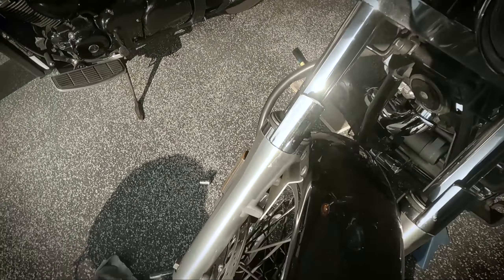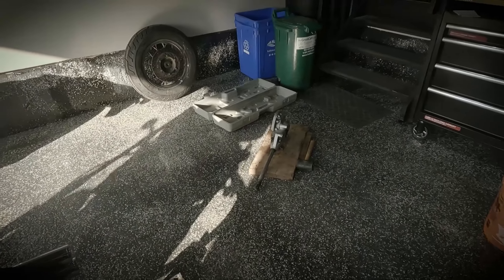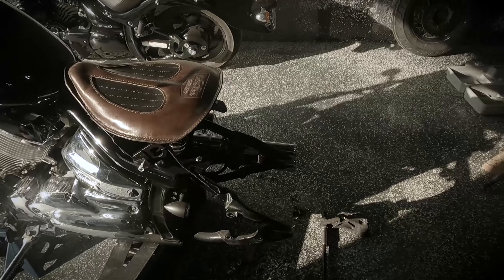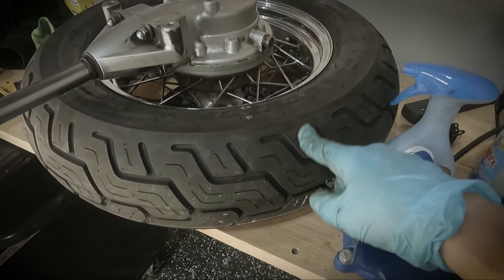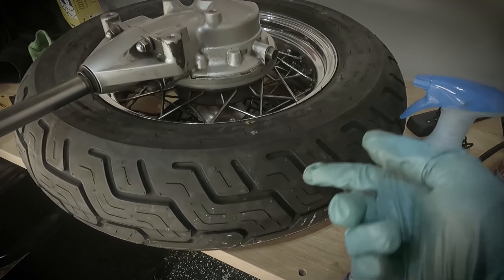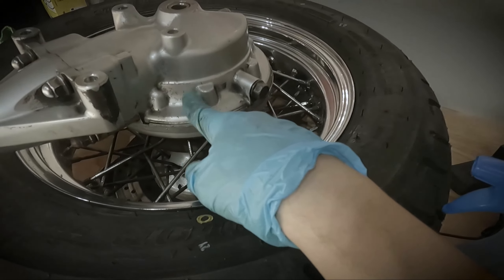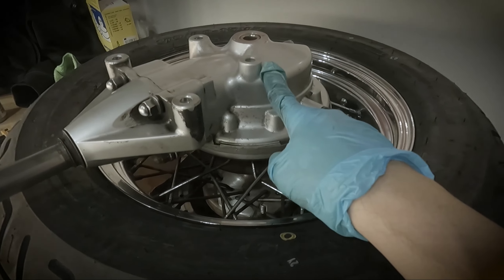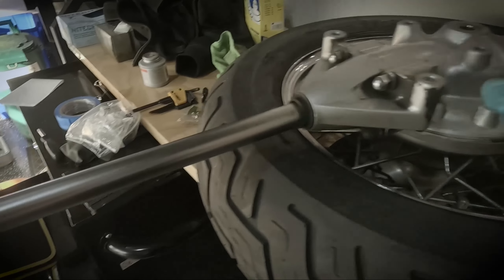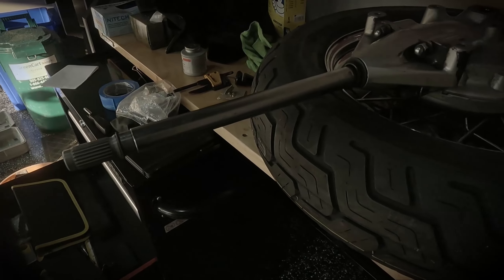It rotates, it brakes — it's good. Let's do the same with the rear: clean up the old grease, clean up the wheel, and get it on. The wheel is ready to be mounted. I had to pump it up with more air because the bead wasn't set in one spot, so I sprayed it with more Windex to get it slippery so it could pop and set properly. I cleaned the splines, gears, and inside of the hub and put fresh grease in there. I'll add more grease to the axle before sliding it into the bike.